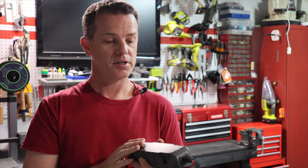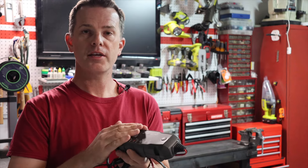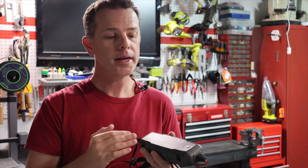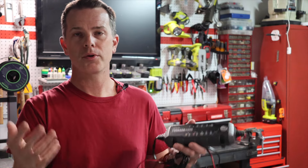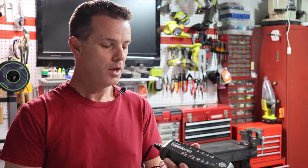The other thing to consider is it's not a quick process. When I put it on my Supra battery and on this other battery, it took one to two weeks depending on the battery to complete the cycle. So if this is your daily driver, you're going to have to re-plug it in each night and it's going to take a long time to do any good. If it's a battery you can let sit — like a riding mower, motorcycle, or something you're not using every day — this might just be the ticket for you.